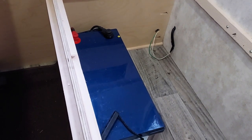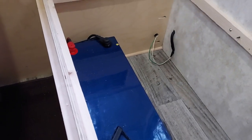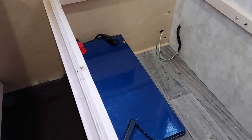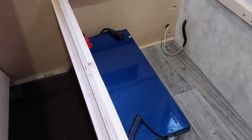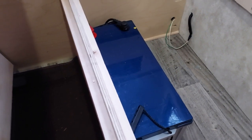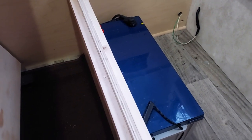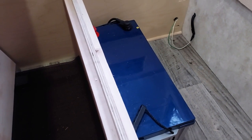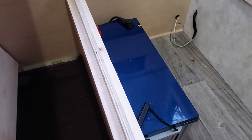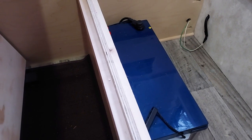I'm going to put a vent in the floor and then a vent in the wall by that wire going through the wall. Now let's talk about the batteries. Your regular flooded lead acid is my secondary battery — a 200 amp hour battery. I decided to go with the gel cell. My research shows AGM batteries will last twice as long as flooded batteries, and this gel cell will last three times as long. I just didn't see the expense for a lithium battery. With this battery we have to put the vents in — it really won't gas much, if at all.